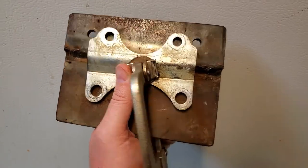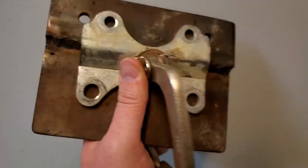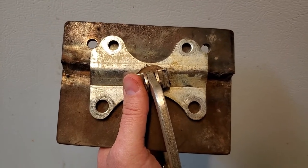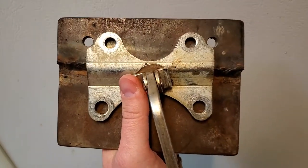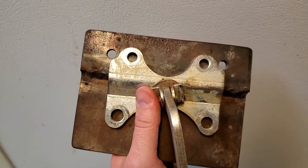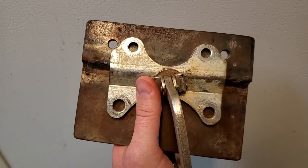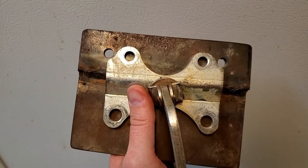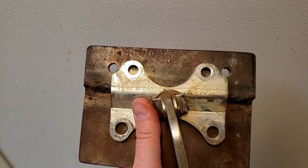I had my friend weld up this piece of steel on this lap joint, because basically for the caliper that I'm using, I need to bolt it on one side and I need that exact height and I need the offset by itself. So this is perfect. I didn't cut it quite straight, so you notice it's a little bit crooked. It's a piece of scrap steel, so I already had some holes, but I've got the axle side — which is the top that you're seeing right now — laid on here in between those holes and I've scribed it where I need it cut and I've center punched my two holes.